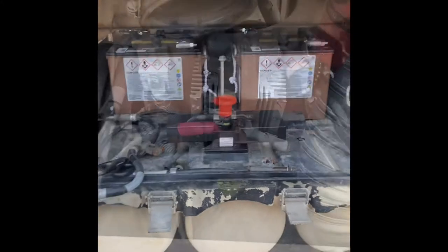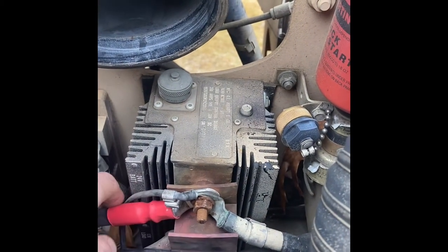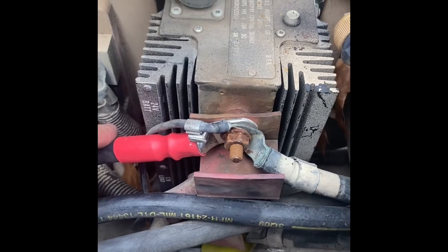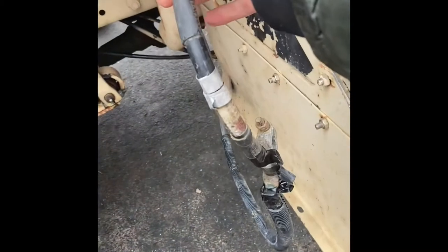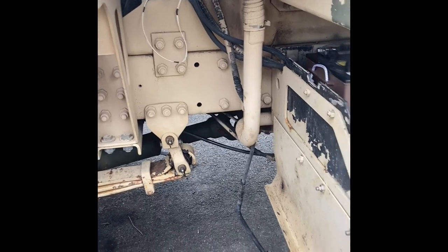Here's the polarity box I'm working on — a little corroded here, but everything tested fine. I've got my new 24-volt line that's going to go to the battery disconnect. Next I'll take care of the 12-volt down here — put a new line down; that's the one that was in really rough shape. This is that 12-volt line right here — it's got all sorts of connections and the connections are starting to fray. All this is coming apart, so if any water gets in there it can start to corrode. I think those are all stainless so they probably don't corrode much, but these are all going to be properly capped and lined up.